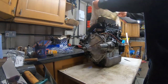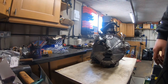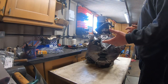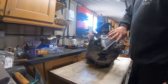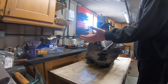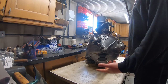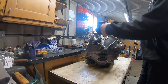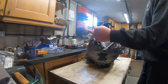In this episode we're turning our attention to the clutch. Let's spin it around for better access. The pre-Verto clutch is a slightly different style to the Verto — the clutch done previously on Luke's was a pre-Verto. This one has the slave cylinder mounted actually on the bellhousing, whereas before it was mounted up here with a longer arm and a longer push rod. It's a self-adjusting clutch, so once the clutch travel is worn out, a replacement is required. I need to remove all the bolts around the bellhousing and this bracket — two bolts for the slave cylinder and three bolts for the bracket.